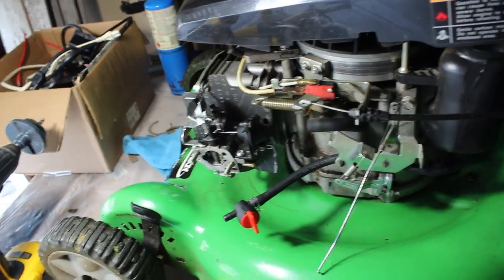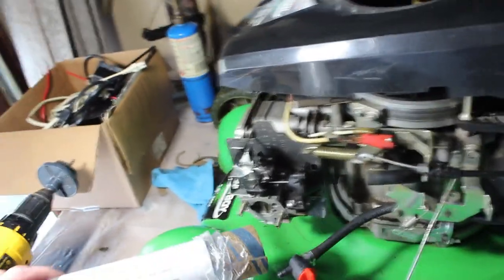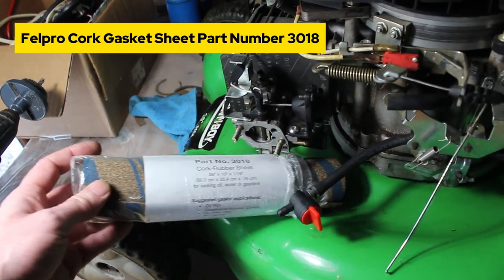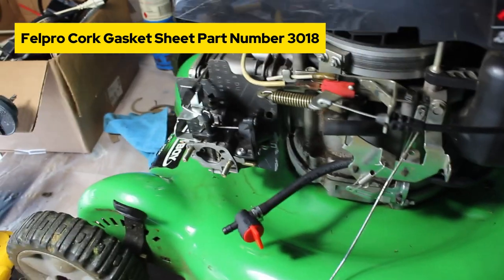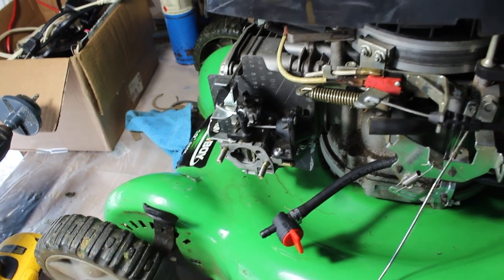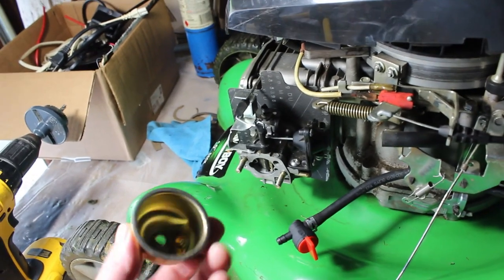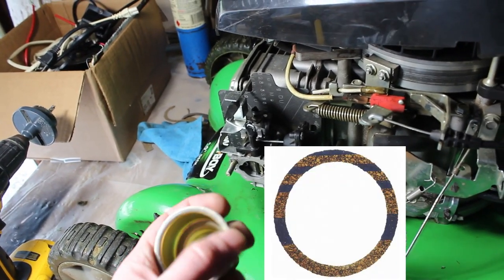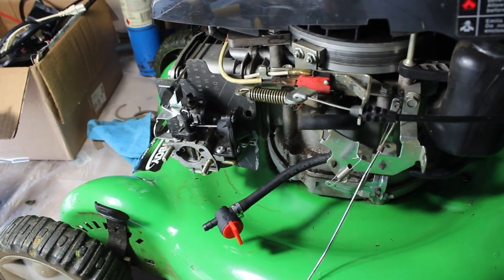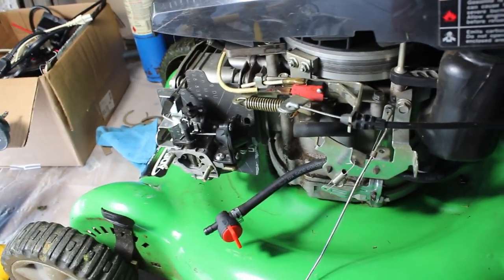But first what we're going to have to do is remake a gasket. I do have this gasket and I could just order it, but I have some gasket making material here — this is cork rubber sheet gasket. It's going to be a little difficult to replicate because the original is a rubber gasket, which is a lot different than cork, but the cork will work if I can cut it perfectly enough to fit around this ring and seal it properly. It might even do a better job and last longer, so I like the challenge of working with what I have.